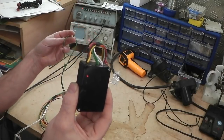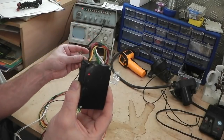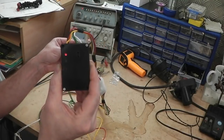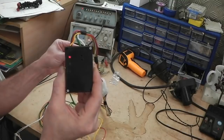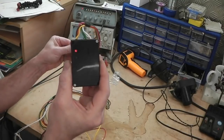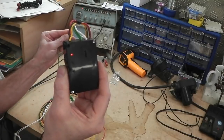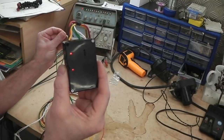And now when I release the brake pedal, you don't want it. I don't want to be stamping on my brake pedal and clicking this, click, click, click, click, click. So it uses that same timer, that second timer, in conjunction with this pedal. So now when I've let my foot off the brakes, it takes a while to come back online.